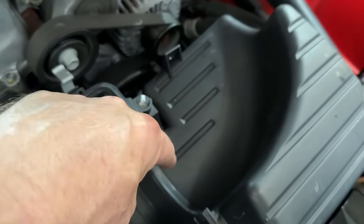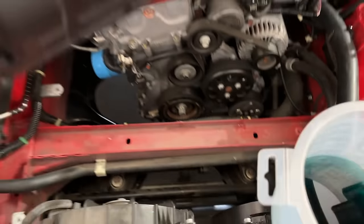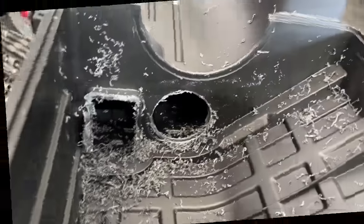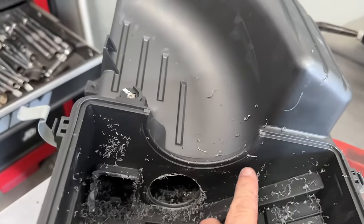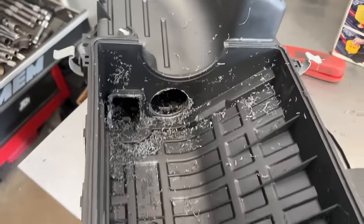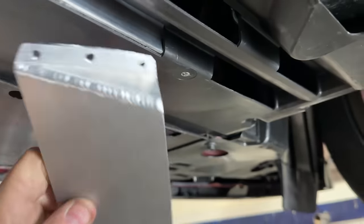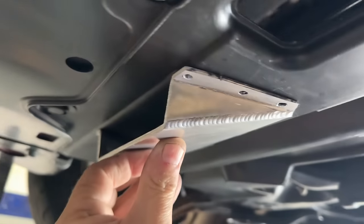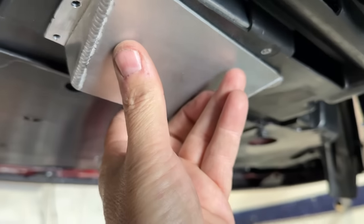You've never seen inside one of these - I'm going to cut around here, basically make these two cavities into one, then drill a hole at the bottom for our tube. We've got plenty of room on this side going into the bottom of the box. Just cutting a hole and pushing through - there's a huge cavity in here. I'm going to cut all the way up here, keep that shape so all the air comes through here into our main box. The manifold goes right there, right above it, and the scoop bolts into that spot.